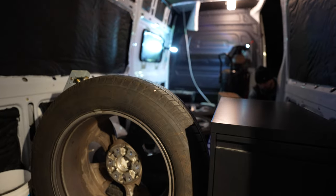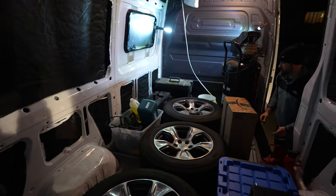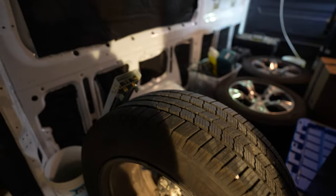So we've been really hard at work installing the floor. We put silicone down on the pink insulation and laid that, and then we put PL300 down in between the pink insulation and the subfloor, and then now we have laid as much as possible on the floor to kind of weigh it down and hope that it clamps together and is even. That was a big task. We have some tires in there and a bunch of other heavy odds and ends. Right, here's what our weighted down floor is looking like.